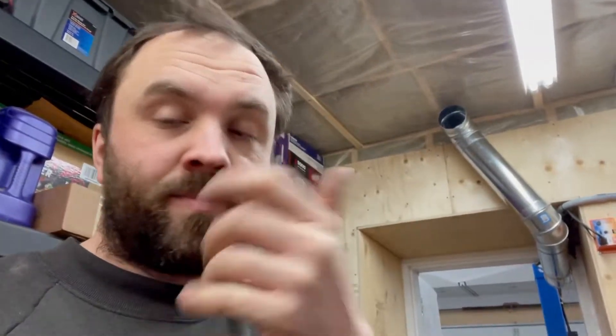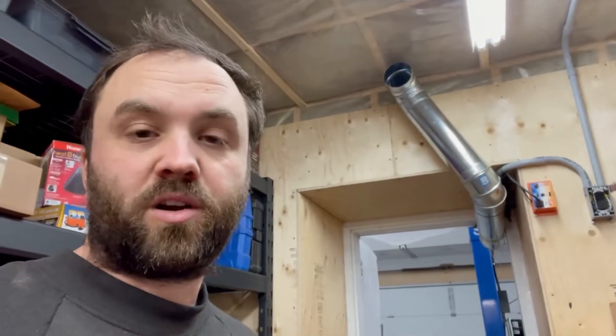Fellow YouTubers, so all the guys with the Grizzly and Yamaha Rhino - the Yamaha Rhino and Grizzlies have issues with oiling the wrist pins on their bikes. They'll rev to 8500-9000 RPM sometimes, and the wrist pin has oiling issues. Personally I think Yamaha dropped the ball on this motor. The 660cc motors have wrist pin issues. I have three motors here and it's all the same issue - wrist pins - and detonation is one big key.